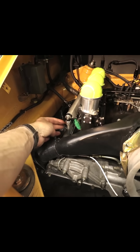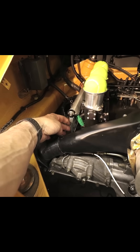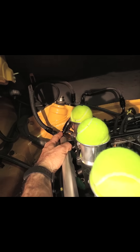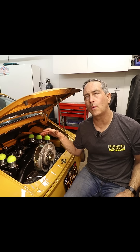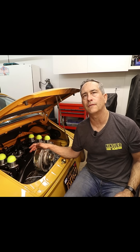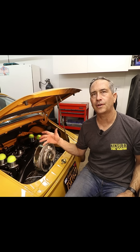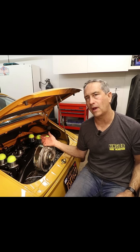Some people are asking why there's plumbing on both sides of the fuel rail — there's plumbing here and there's also plumbing back there. My choice was to go with more the OEM style fuel system, which puts the fuel pressure regulator after the fuel rails or after the throttle bodies.